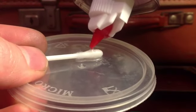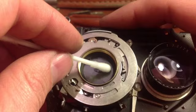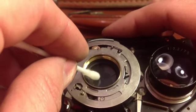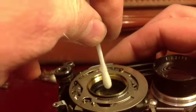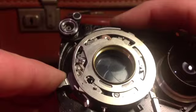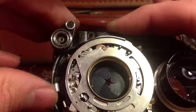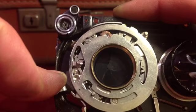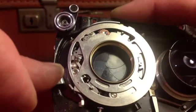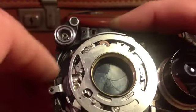At this point I've decided to take the plunge and apply some lighter fluid to my shutter blades. Now, this is a bit stupid because cotton buds are made up of lots of tiny little bits of cotton, and any one of those could have fallen onto the shutter mechanism or been transported in the fluid, making it worse. I don't recommend doing this with cotton buds, but I just needed to get some on there and I'm lazy. I'm trying to work it in before it all evaporates but the shutter is not firing. I've heard people say that when you have fluid on it, it does ease up the action — not in this case, but perseverance will see you through many things.